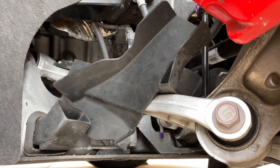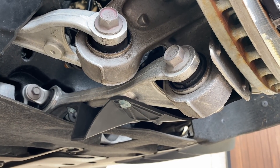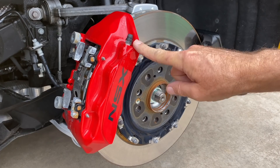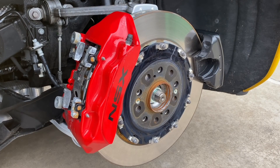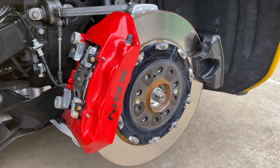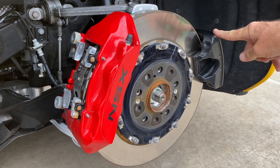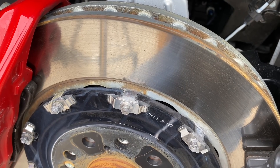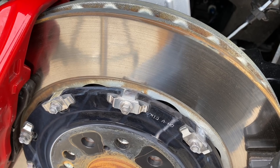Here's the forward lower link with its air deflector back on. The lower lateral link has a scoop attached to it that shovels air up against the back side of the rotor. This is the main brake caliper — a four-piston fixed caliper, two here and two more on the back. You'd pull the pins to remove the pads, and these two bolts are what you'd need to remove to take it off. Up here is a parking brake caliper — that's all that does — and it's electronically actuated and holds the car quite firmly. Just like the front, the rear uses two-piece rotors, and you can see here how the hub and rotor are attached to one another.